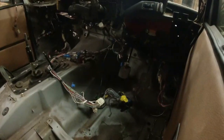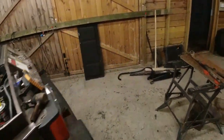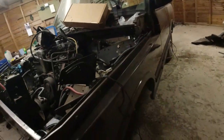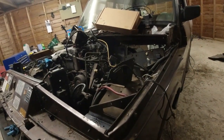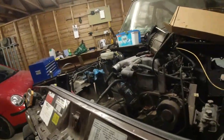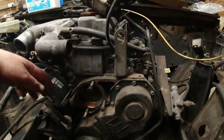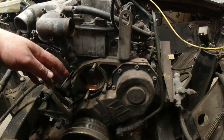I haven't really done anything else in here. I diagnosed the cables — I think I mentioned that already. I found out I've been a bit of an arse about the viscous fan. I thought it was knackered, but of course there's no coolant in the system, so it was just spinning — no resistance at all. It was actually spinning with the water pump pulley. So the viscous fan is fine. I did manage to separate it from the water pump, which took an incredible amount of effort — basically putting it on the floor — sacrificing the fan blades if anything, because I've got another set in the barn. But it came off in the end. The viscous fan is now free. Bone dry, of course.